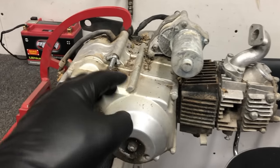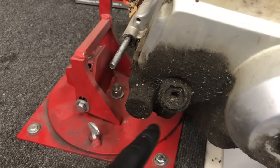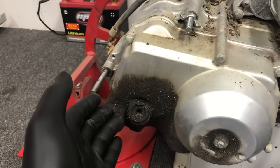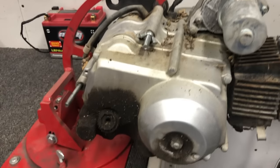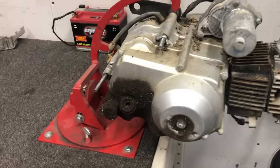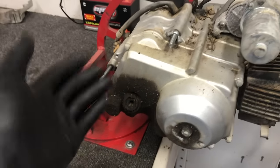I'm not so concerned about the top end, but I am concerned about any water that would have dripped down into this case. You can see all the oil that has overflowed and accumulated on the outside, and that is super concerning. There is some hope — maybe that last owner overfilled it with oil and it just kind of seeped out, or maybe they did some service work and tilted it on its side. But that's probably not logically the correct answer. It's most likely going to be water, but we're going to find out in just a second.